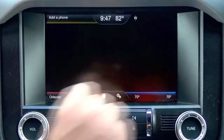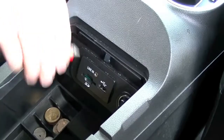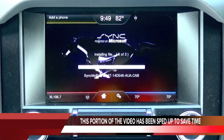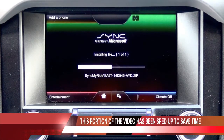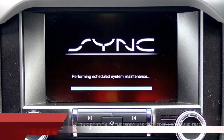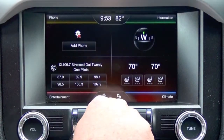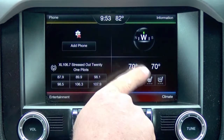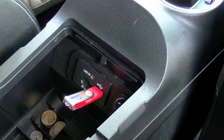So now we'll hit OK, remove the number 1, and install the number 2 file. You'll notice the home screen will reappear — just allow this home screen to stay on for about 10 seconds, that'll let you know that update stick number 2 is done. You would notice it shut down 2 times, and now that it's back at the home screen we know stick number 2 is complete. So we'll go ahead and remove that.